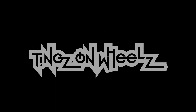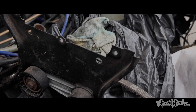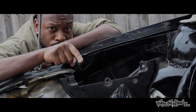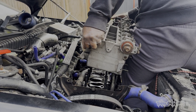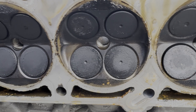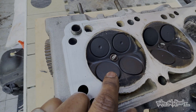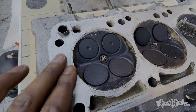Do you see anything wrong here? Let me rewind a bit. The head had to come off after doing the timing belt. I saw something in the cylinder that didn't look good — turned out it was just a bit of burnt carbon. But just as well I did, because we got something going on here. Everything looked fine at first glance, just a bit grubby. Before I clean it up, I want to see that these valves hold a nice seal. No point cleaning it all up just to find out it doesn't hold any compression.